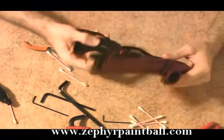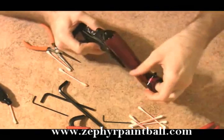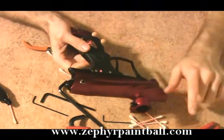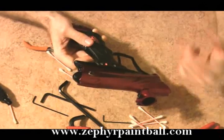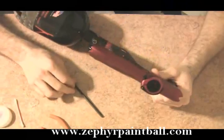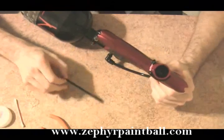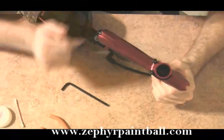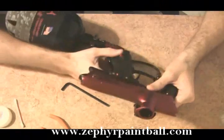Turn it on. Okay, let's check to make sure our eyes work. And they do. Alright, cool. So what we're going to do is we're going to put this back together again, and we'll go out and do an efficiency test. Now, a common question that I get before we go out and do the efficiency test is, what should I set my LPR at? Dye recommends 3.5 turns from all the way in, back it out 3.5 turns.